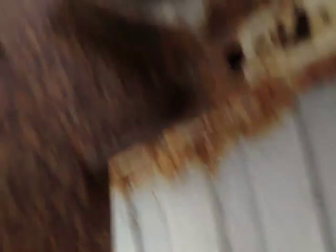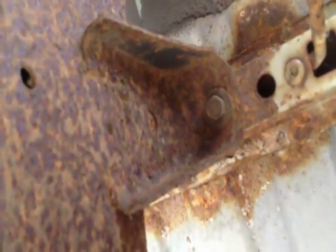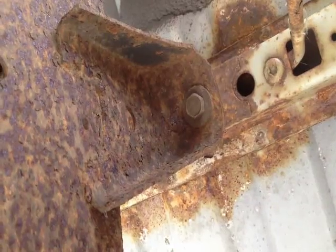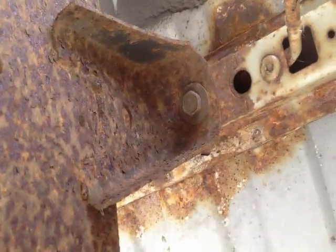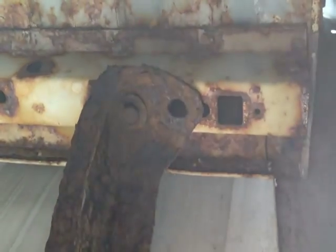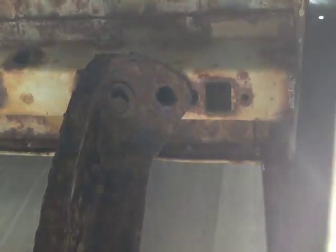What I'm going to do is look for all these points — like right here — that are bolts connecting the bed to the frame. I'm going to hit those with some PB Blaster, let the penetrating oil soak in, and get those out of there so I can work on getting this truck bed off. Once I do that, I can start figuring out where the motor is going to go and how I'm going to attach it.